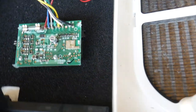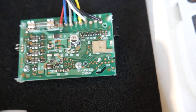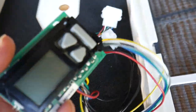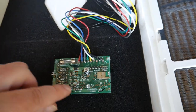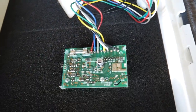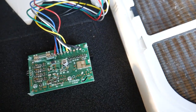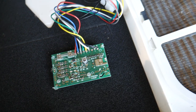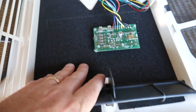I went back to the box and sure enough, it was damaged in shipping. There was a capacitor in the bottom of the box that probably should have been on the board. I did reach out to the company and they were very, very good — they sent me a whole new circuit board to replace this one. And lo and behold, there is a capacitor there. Without that capacitor, going to low cool was causing all sorts of issues and kicking the breaker.